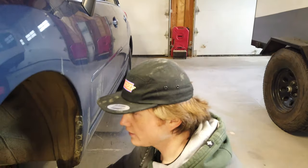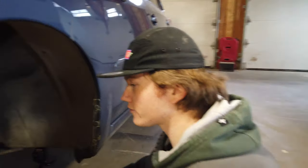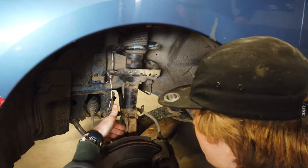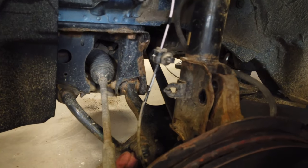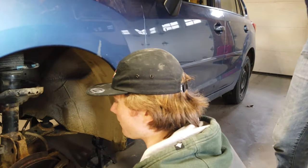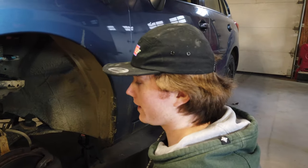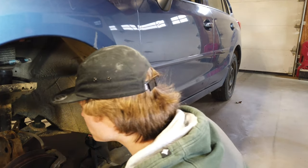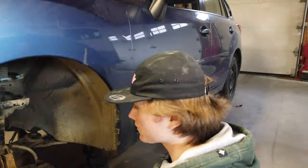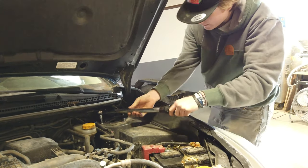We're doing good - the left side is in now finally. Spacers are all laced up on top. We're having trouble getting the camber bolt and the bolt that holds the bottom of the shock in because the sway bar link is giving us tons of trouble on both sides. We're cutting them and going to AutoZone for longer ones. ADF doesn't recommend that but it might help. Once these are off it'll drop in and we'll be good.